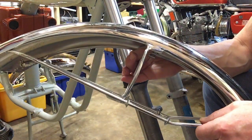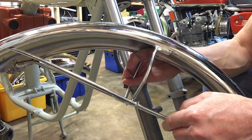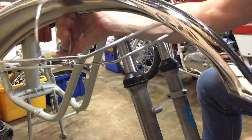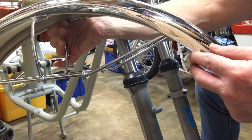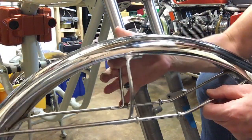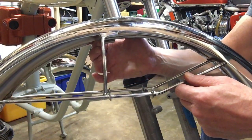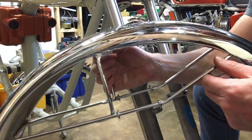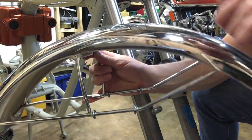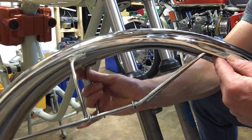Originally, when these bikes were first produced, they didn't have this centre wire stay, and that was added at a later stage to the design when they realised, with respect to these mudguards, especially the longer ones with the longer nose, which were for the home market, that they were fracturing at the front due to vibration and inadequate securing of the mudguard. The US ones were shorter and finished about here. An extra stay was positioned. What they did find though, is that with the original two mounting point mudguard, if there was a front number plate fixed to the top here, that acted as an additional brace, and those mudguards with the front number plate mounted didn't fracture.